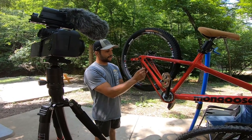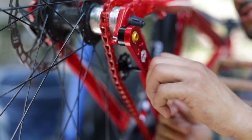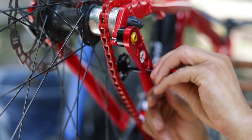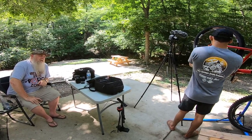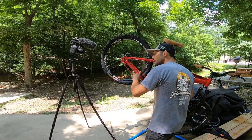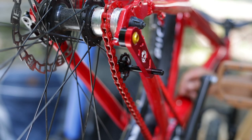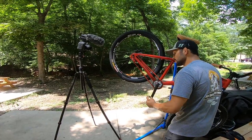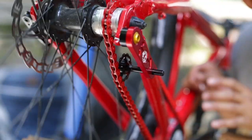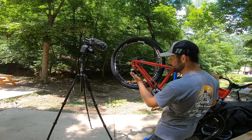Okay, jockey wheel is going to go here. It's actually clearing the chainstay — that's one thing I was worried about running on the bottom half, but it's clearing it. Do you think when you pedal it's going to hit the chainstay? No, I don't think so. It tensioned the crap out of it — holy crap. Let's try it like that and see what happens. Dude, that is like taut now. The only thing — remember this chain's like a BMX style chain for the whole one-by. It adds a little bit of ticking noise, you hear that? I'd rather that than the chain slapping up against the chainstay protector. Very cool.